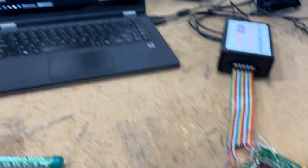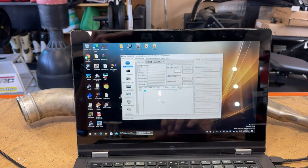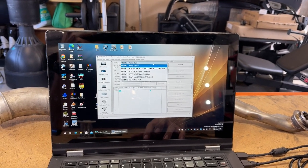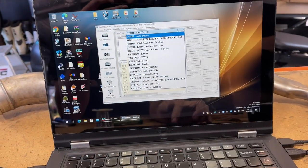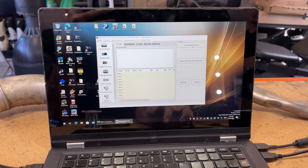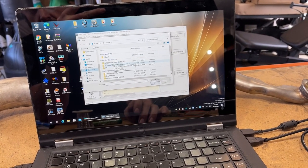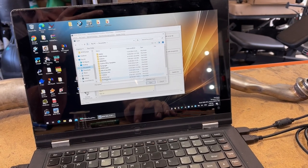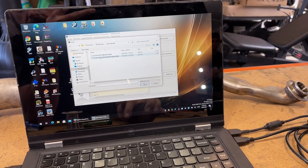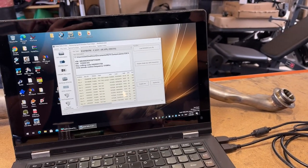I've read the flash from that. I'll probably make another few copies while it's still connected — just read the EEPROM and the flash again. In the meantime, let's open up BIMtool and get on with the video. We want to do CAS key learn and we want to learn it through an EEPROM read. We have an EEPROM from a CAS3 Plus. We're going to load the EEPROM file — it's James's E92 M3. We want the EEPROM which is the small file. Let's open it up and see if it's got all the key information. Yes it does! Woohoo! We have successfully got into the CAS.